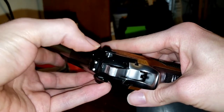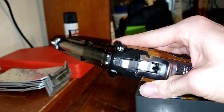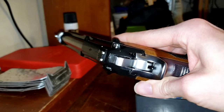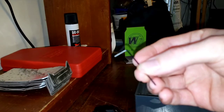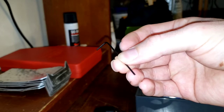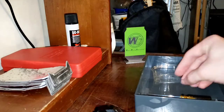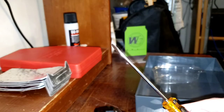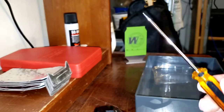Gen 1s only have one screw. The one screw on a Gen 1 is 1.5 millimeters, while the Gen 2 and ATV 2 series is a 1.3, which is very small. This isn't something you can get in one of those multi-pack kits at Walmart. You're also going to need a very small flathead screwdriver — this one is actually too big but it's the smallest I have.